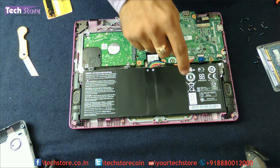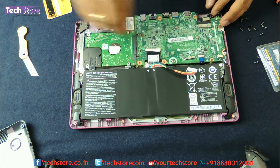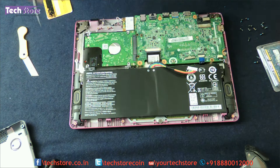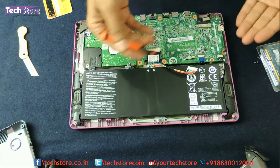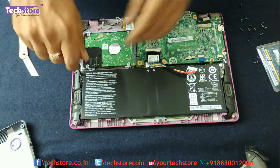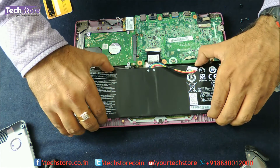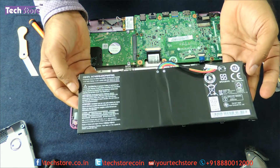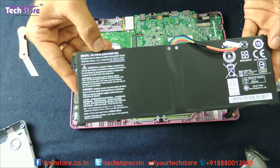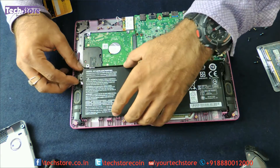The first thing to do is remove the battery. This connector here is connecting to the battery. You need to remove these two screws if you want to replace the battery — if you don't want to replace the battery, you can skip this part. Remove the two screws and the battery comes away. You just need to buy a similar battery; the part code number is AC14B18J here in India.